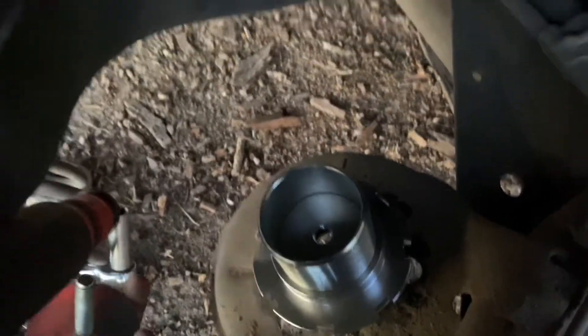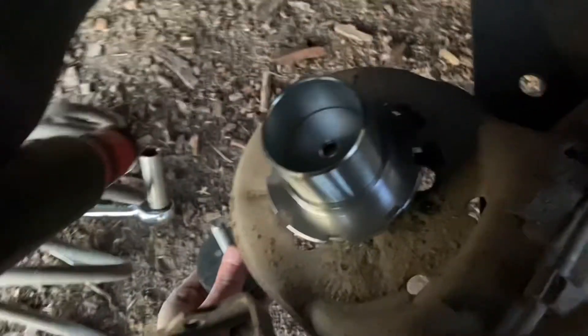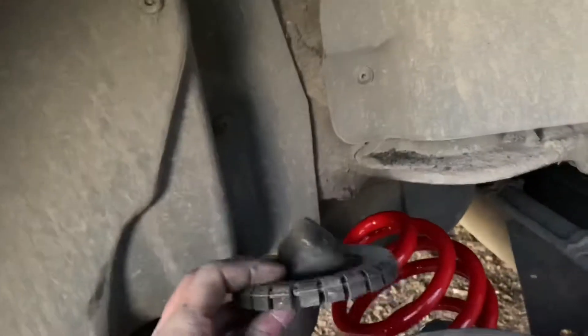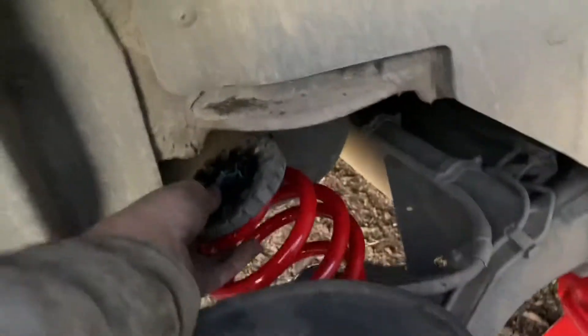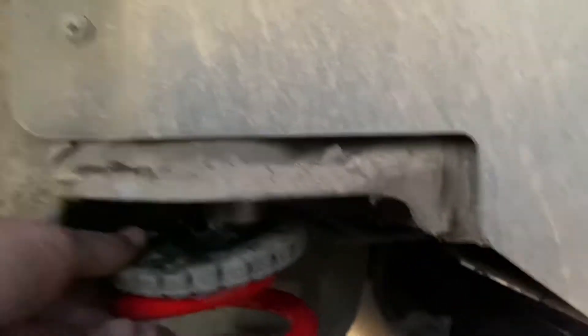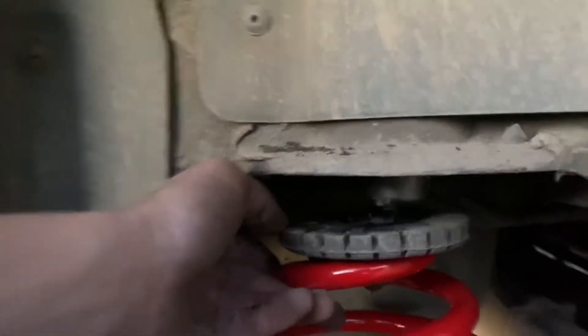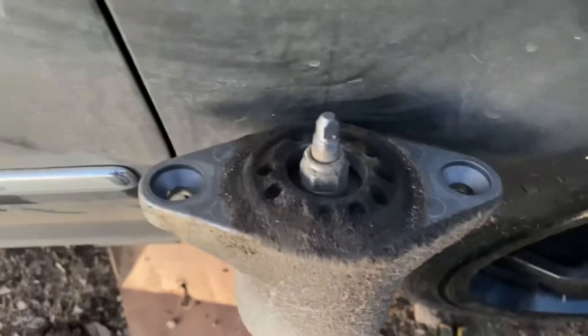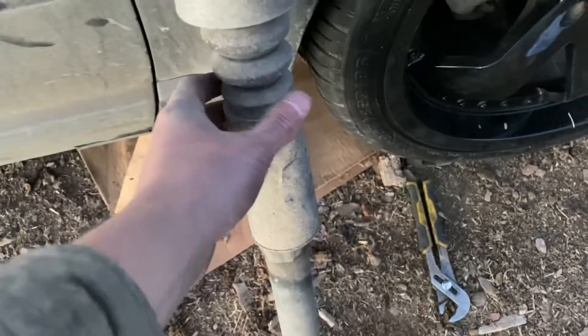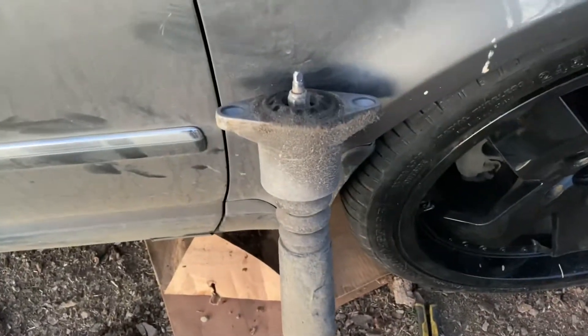Rear of the car, you put that right there. And then you got this right here with the giant washer that goes on the underside and bolts that to the lower control arm. You have to utilize this right here so it's not squeaking metal on metal. On the stock strut, you're going to want to unbolt this and take this bump stop — that's all you would need off the stock strut to put on your new strut.